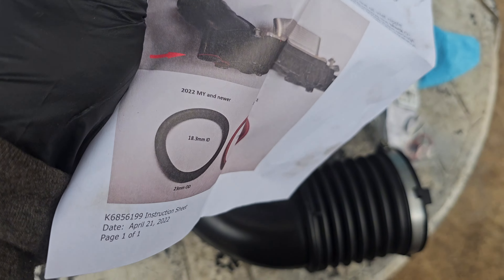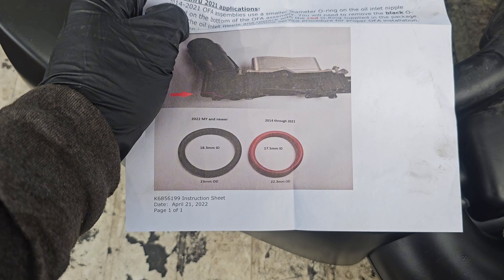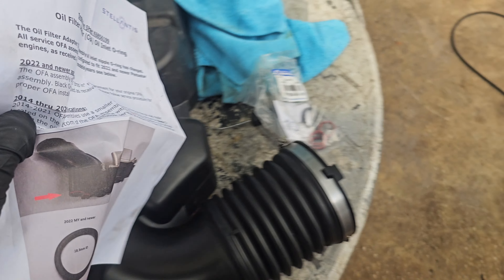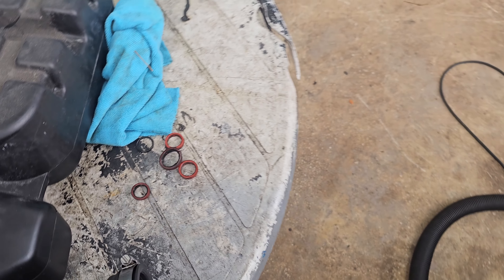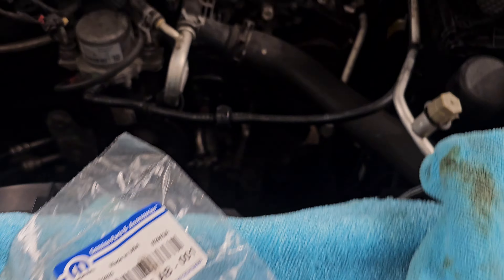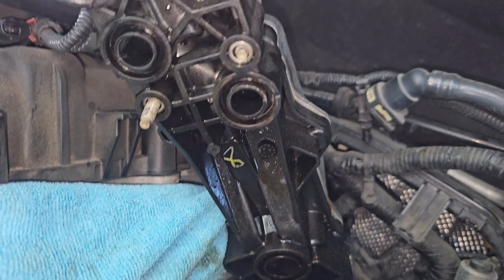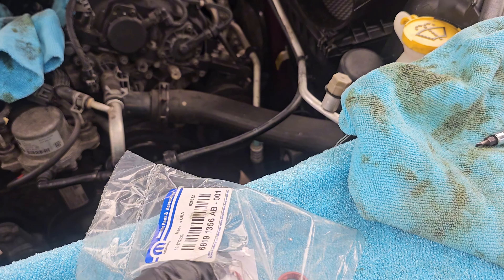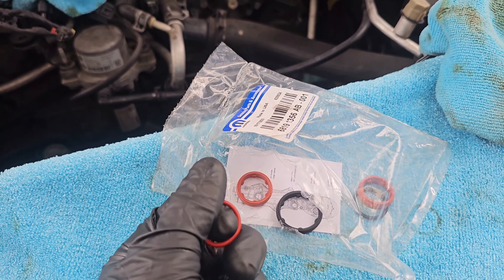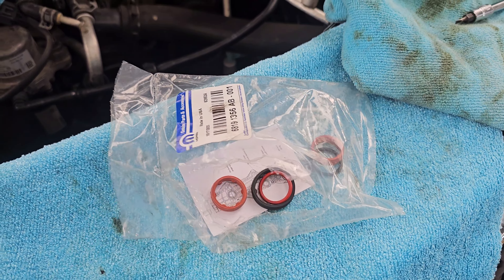Two different o-rings: 22 and up is a black one, larger diameter; and 14 to 21 is a red one, smaller. We're gonna use the red one to replace all those seals here. Old oil cooler seals — here they are, completely flattened. New ones right here. Cleaned up those holes where the seals go and cleaned them from oil so they seat a little better. Let's go ahead and start putting them in — you can't really mess them up. The rest of them just go size by size.